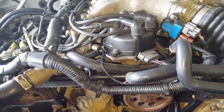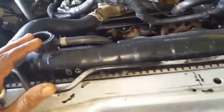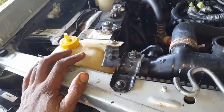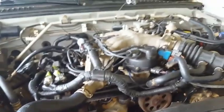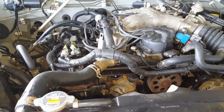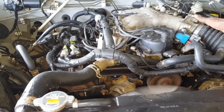Let's go ahead and start the engine. Battery is connected. We want to keep the radiator cap off and make sure we fill the overflow to its recommended max level. During the startup we must remember to air bleed the cooling system. In the video description link there will be a video on how to air bleed the cooling system to prevent the engine from overheating.